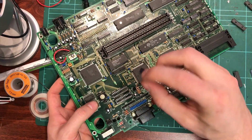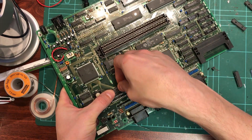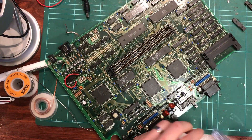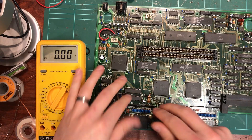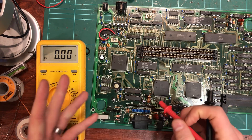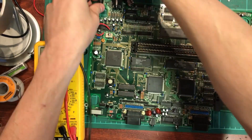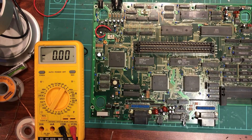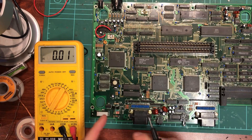Take note of the orientation - chip notch goes to the socket notch, and that will go in. Let's do the second one. They're in and sitting pretty well - not completely perfect and straight but good enough, making nice electrical connections. I'm going to plug it in and give it AV. No game at this stage - we'll just let the built-in diagnostic colored screens tell us what's happening.